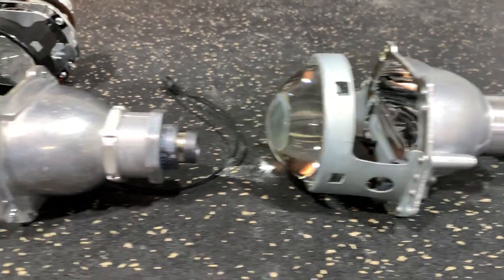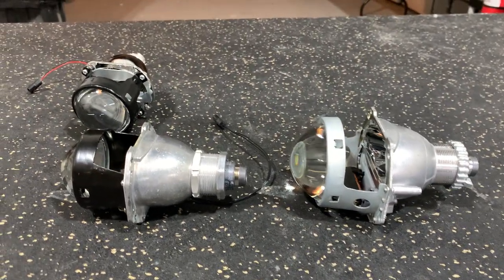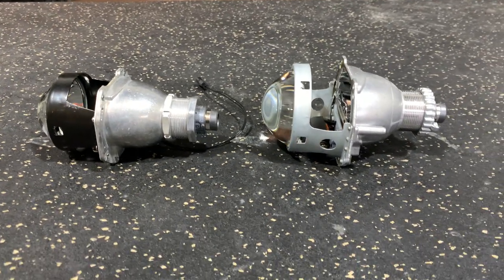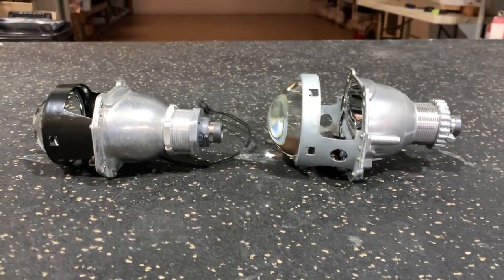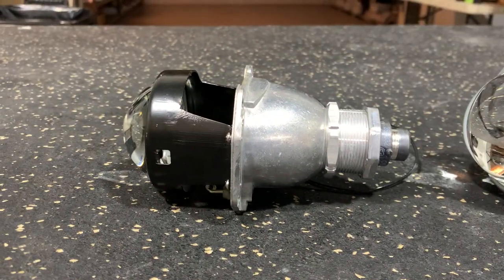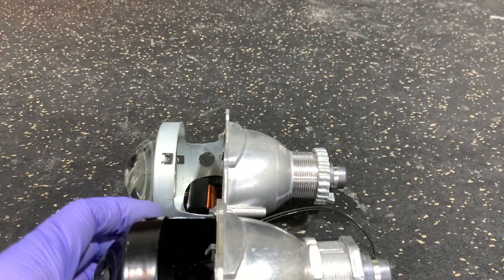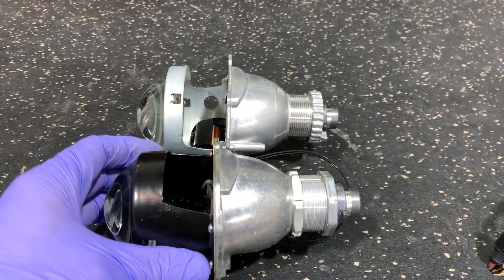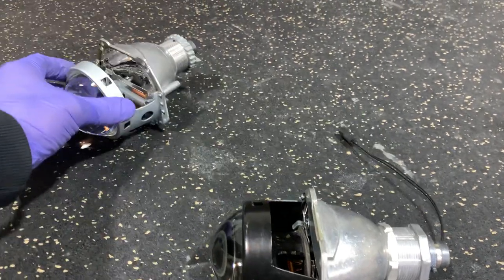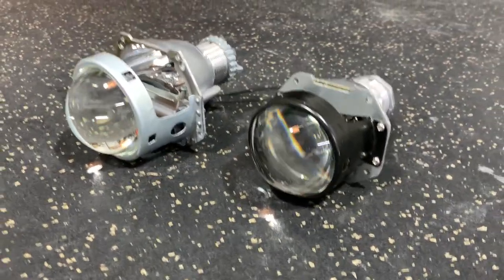It's all variants of the same unit with small little changes. When you compare those two, you can see there is quite a bit of a size difference. Taking the H1 projector out of the mix — we were just comparing it for size — now you can see where the Micro gets its name. It's a lot smaller, uses the same bulb, same size, threaded shaft. As far as fitment on the rear end, it's going to fit about the same, and it's the front end fitment and the ability to make everything really compact.